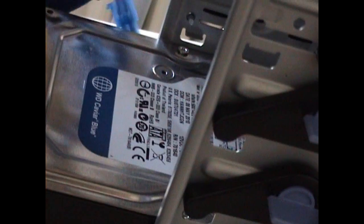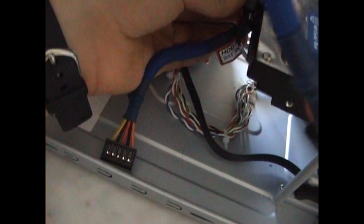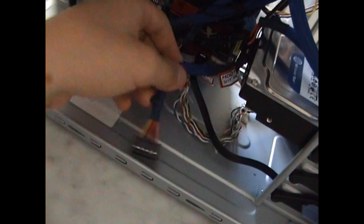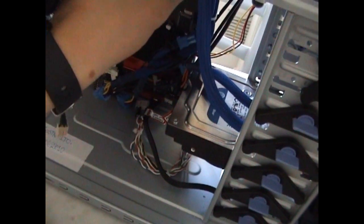The hard drive also requires power. Have a look at your PSU — you should have a SATA power connector. You normally have more than one for hard drive bays. Choose the one that is most convenient for length and position inside your casing, then snap it into the hard drive. Now the hard drive has power and will run.